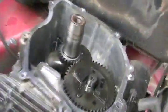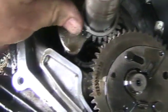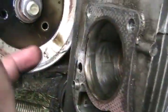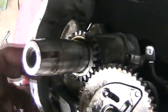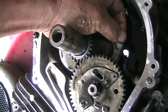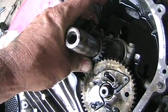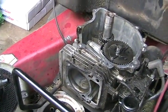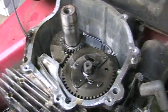That just took a couple of seconds to slip in. Make sure it's in the right direction and not flipped the wrong way, and make sure it's not going to interfere with your crankshaft while sliding it down to bolt on. Once your piston is all the way in, add a little more oil there and lots of oil on the crank pin journal. Then put the rod cap back on and tighten it to whatever the torque specs are. Rotate the crankshaft around a couple of times to make sure everything spins freely without binding before reassembling the motor. Give one last check that your cam timing dots line up.